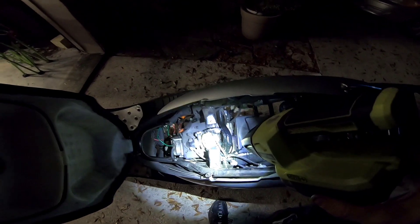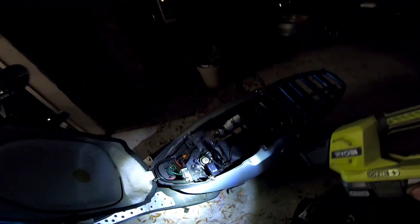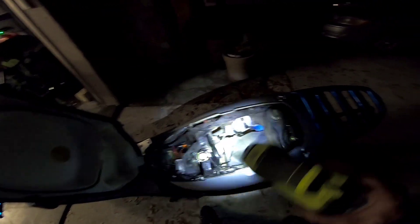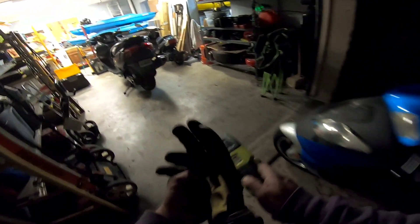Alright, let me see what I got going on now. I took the whole filter out. For this to work properly, he needs to get a pod filter — it is not going to accept the stock air box anymore without knowing the original jetting size of this thing. So I took it off. I'm going to bring a Phillips head screwdriver with me in case I need to make an adjustment. Let's try this again. This is how Dan operates. And if I'm right about this, then all he needs is a pod filter.